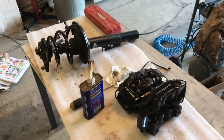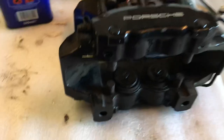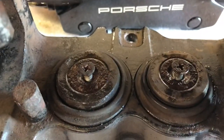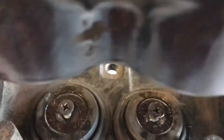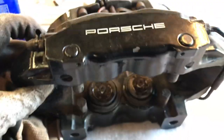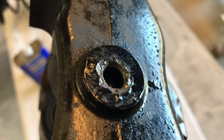Quick update: I've got both struts disassembled. The first one is over there with all parts apart, and this one is nearly done. The problem I'm finding is that the brake pad backing plates — the resonating plates that fit into the brake pistons — have one side that won't come out. I've broken off the thin metal plate they're screwed to, though luckily the screws came out. I've put some rust remover in there. You can also see there's a bit of damage around the brake line area where the steel brake line thread fused to the alloy.